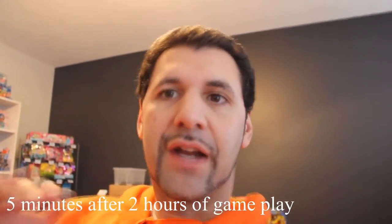Okay, my normal run time was 35 degrees just idle. And then when I started playing games, it would hit 55 to 58 degrees. And then once it hit 60, I had to watch it while playing games because it would freeze my game up. And then 61, that's it. The computer would shut down. I think 62 is the max that the processor can handle. For AMD anyways, the 8350. Intel's, you're gonna get an extra 10 degrees-ish better, so don't have to worry too much about that.